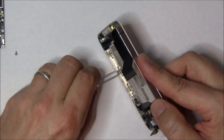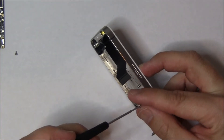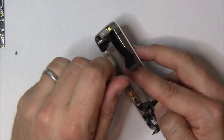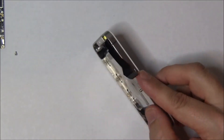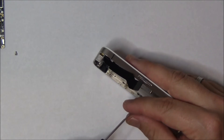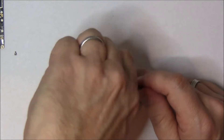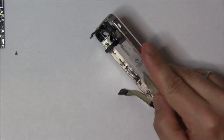Here we're putting in the side screws. You can see the placement of the washers on there. The best thing to do is to have a pair of tweezers that are not magnetized and a screwdriver that is magnetized — that'll help speed up the process. This is the hardest part of the entire thing because it's just tedious. One of the reasons to install the corner screws first is it allows you to hold down the screen to make sure you get a good seal between the screen and the midplate.